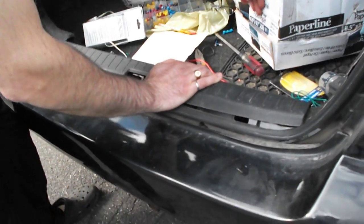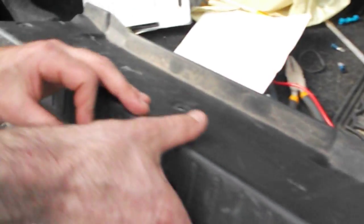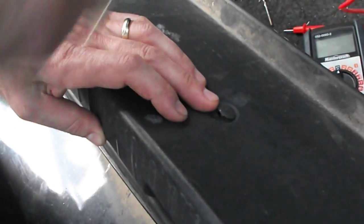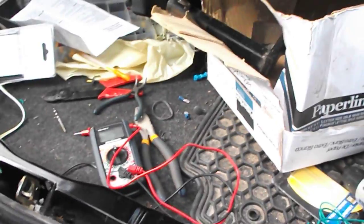The other YouTube videos talk about how to get this plastic cover off, and I'll quickly show you. There are little clips that hold it in place in three locations. I slid a standard screwdriver behind it and lifted it, then put pliers behind it and pulled them out. If you just pry with the screwdriver you'll probably break the heads off.